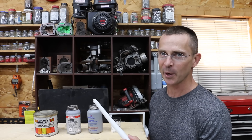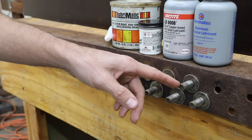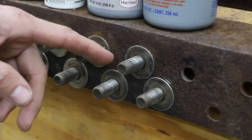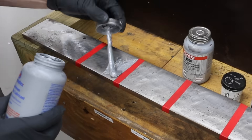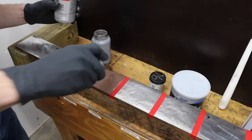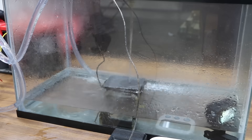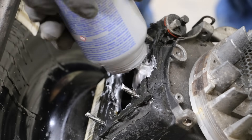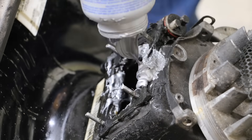So let's get the testing underway and see which option works the best. In the first test, we'll apply these products to some bolts and then do some testing on them after three months of exposure to a highly corrosive rusting agent. We'll apply each product to some steel to see which products actually block corrosion. We'll also simulate water spray-off conditions your vehicle will likely experience to see how well these products resist being washed away. The testing will culminate in a capstone event when we use anti-seize as an engine oil substitute to see if this approach could serve as a permanent protection against engine seizure.